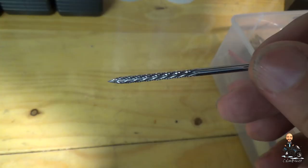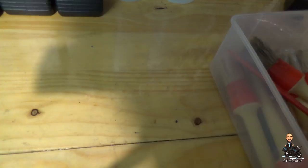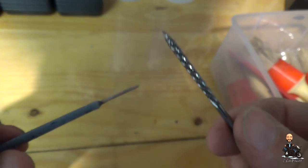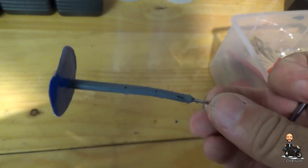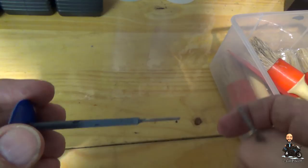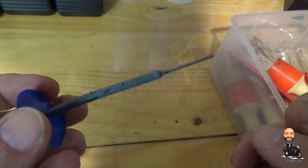And that's then the same size - well, probably a slightly different size, but that's a reamer for a 3mm hole and that's a plug patch for a 3mm hole, so they are matched. If you've got a bigger hole you might need to go to a 6mm. I believe you can't repair bigger than a 6mm on a motorbike tyre. But you might need to go to a 6mm reamer and 6mm plug patch. Always use the right plug for the tool - make sure that they match.